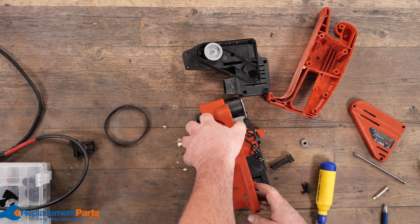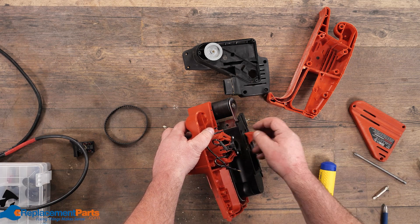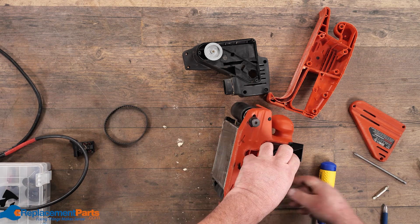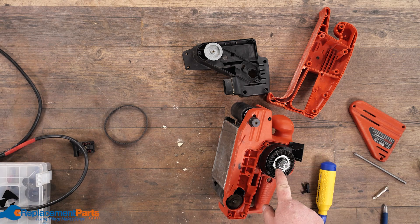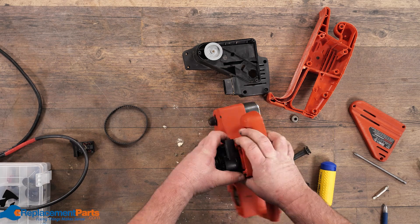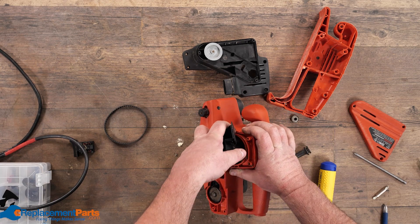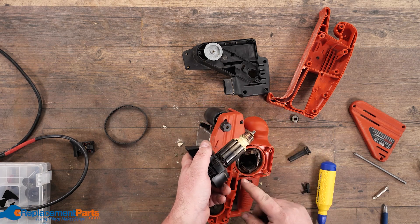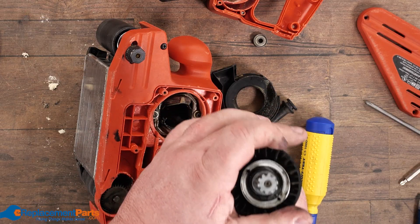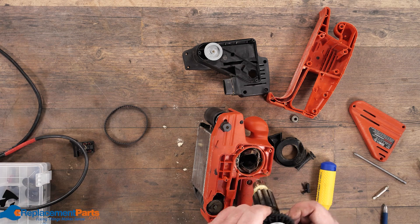We had our one screw on this side that was actually worn out, that was holding the bearing in, holding that side in. On this side it's locked down by the cover. There's your second bearing right there. So this armature — I should just be able to pull it out. And here it is coming out. Sure enough, I can see some burn marks on this. There's another bearing here. There's a metal cover here — you can see this thing's a bit chewed up. It's not centered, it's worn.